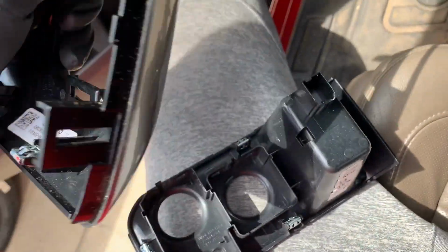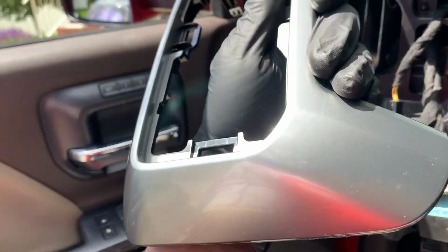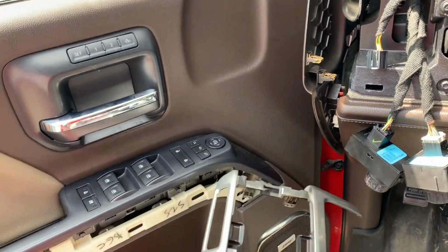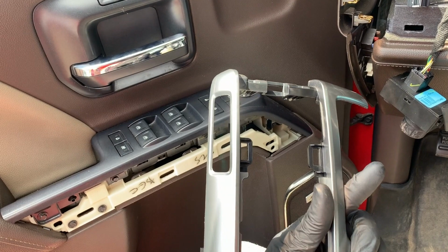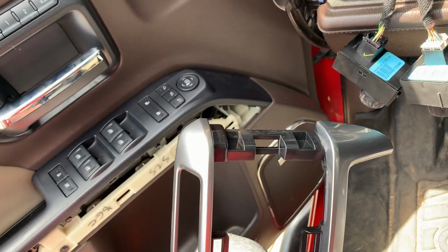So, voila. Now I can either paint, and what I'm actually going to do is use a vinyl wrap. I'm going to white vinyl wrap it and see what that looks like. I might paint it first, just so I don't have to go back if I don't like the vinyl. Wait a week, because you want to wait a week for the paint fumes and chemicals to evaporate before you wrap it, because if you don't, you could get bubbles and all that. So we'll see what's up.